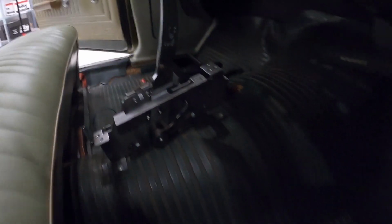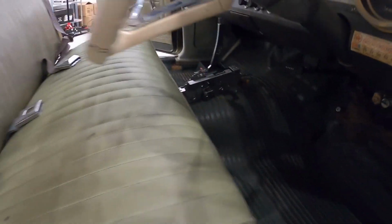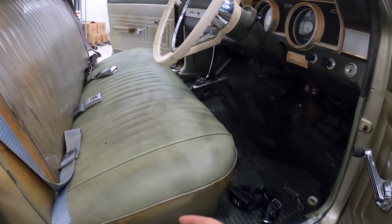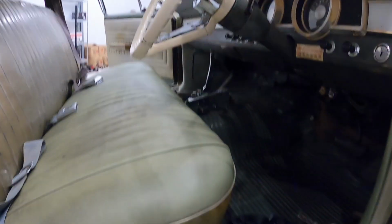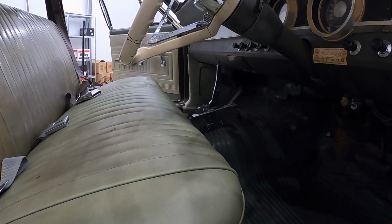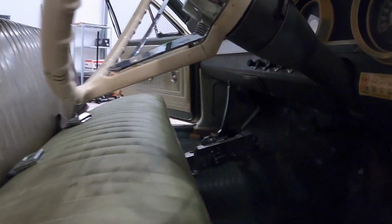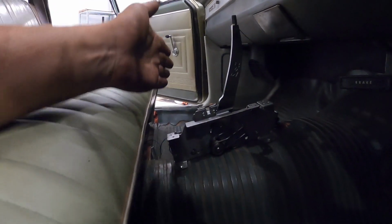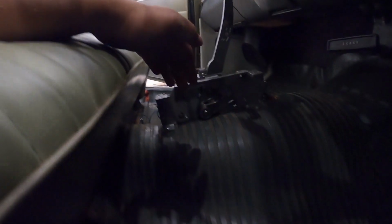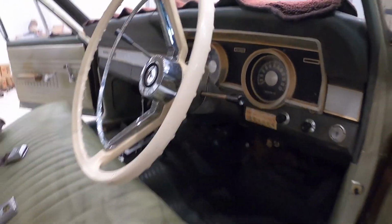We've done our shifter earlier this morning. That's absolutely pro install. Real nice. Generally, you don't want to fit a cable shifter in a car with a bench seat. You kind of run out of room, it goes too far forward, you won't be able to really change gears nicely, but with the right style ratchet shifter or this B&M Quicksilver, it kind of drops back into drive and then it'll fall down and you can ratchet back and forth for second and third, so that before we fitted it, we put it back into first gear and we made sure that you're not going to have any issues interfering with the bench seat in first gear and that the shifter's nice and on the flat part of the floor. That's come up very nicely.